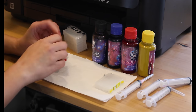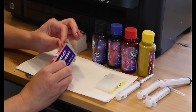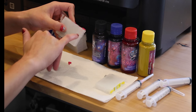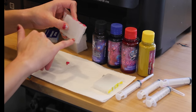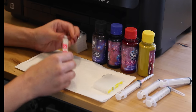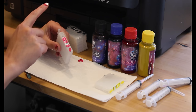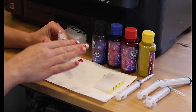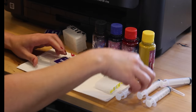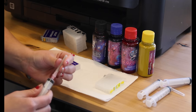The plug configurations will be a little bit different, so check with the manufacturer, but the refill plug is usually the one up front. The one on the back is the air vent — you can see a little chamber back there as an indicator if you're not sure which is which. If you're refilling and that vent is already out, that's okay — it needs to be out when it's in the printer, so just leave it out and refill. Open up the front plug, then get a syringe with the needle — be careful, it is a very sharp needle.